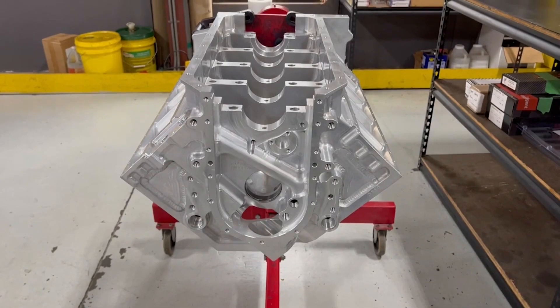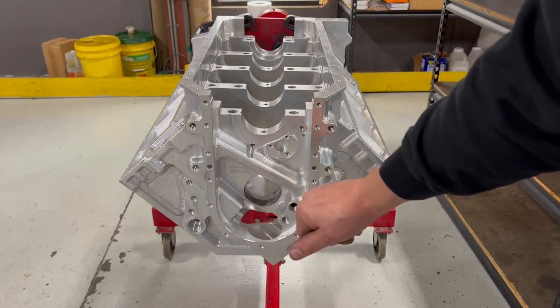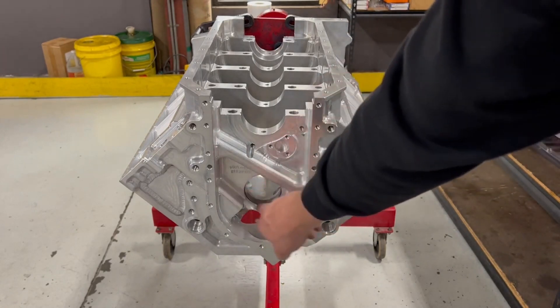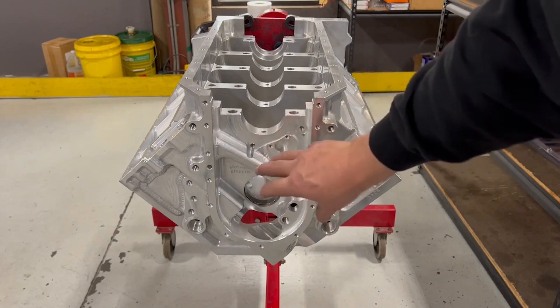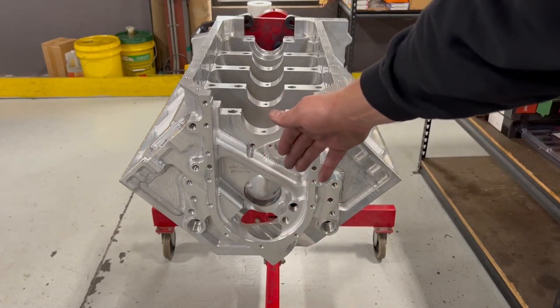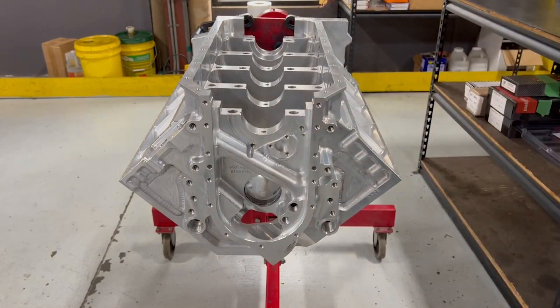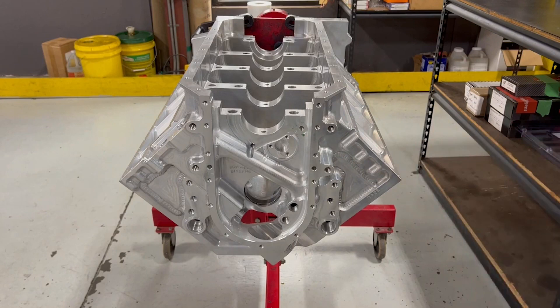When this engine is running and there's an oil film, the babbitt and roller bearings seem to be the same. I am working on a roller bearing conversion, but there's no proper bearing available for 65 millimeter in the bore sizes — the IDs and ODs — that I need. I'll probably do a slight camshaft change to use a common bearing rather than reinventing the wheel. It'll be for oil control purposes mainly. The babbitt bearings run great — even on Drag Week-type stuff — and I'm always amazed at how well this little skinny bearing works with just oil pressure.